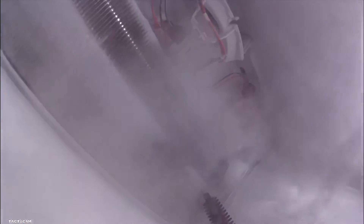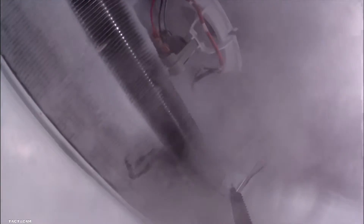So if you need to defrost this refrigerator like I'm doing, don't use a heat gun — don't use a heat gun. You'll do more damage than getting this thing fixed quicker. Use a steamer, or spray some water on it. If you melt the liner, you're just going to cause more problems than what you're saving. So if ever in doubt, just leave this thing unplugged. But if you need it ASAP, use a steamer. You won't hurt anything — it won't melt any plastic like a heat gun or a hair dryer would.